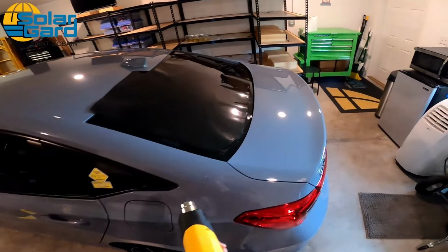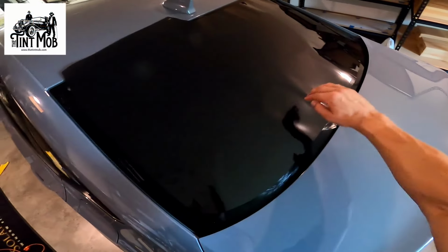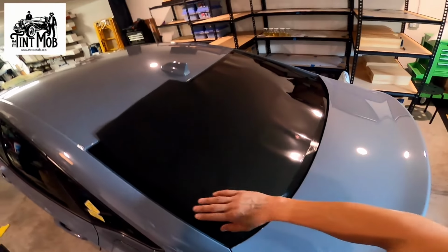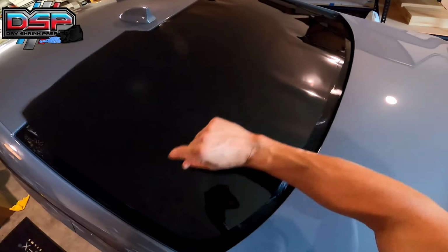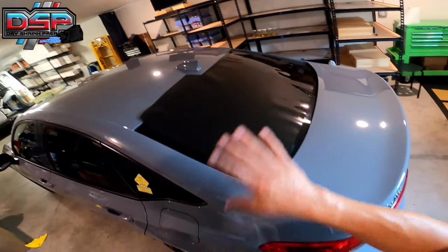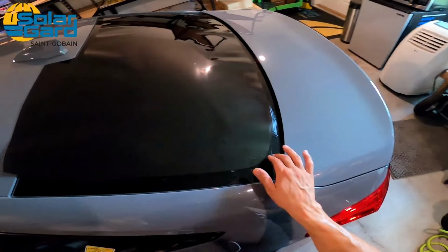And just keep in mind, don't forget, we're talking about those light squiggles, right? We don't wanna see those aggressive lines. Once you get to a squiggle, that's good. If you keep heating it, it'll start getting aggressive lines, and we don't wanna do that. You're at the verge of over shrinking it at that point. So we wanna avoid that, okay?